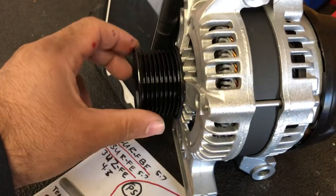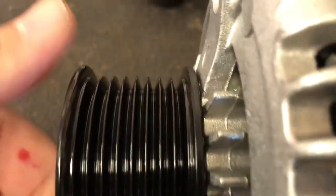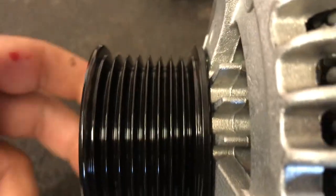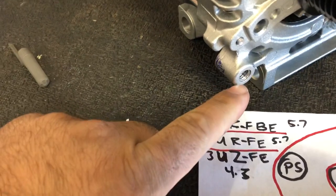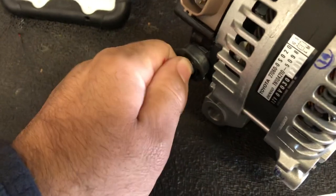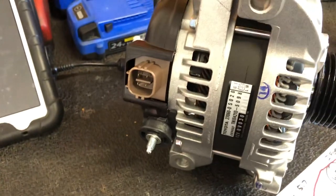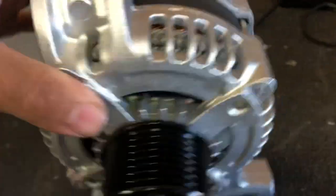Here's what the alternator looks like new. Clean up the mounting surfaces, make sure the pulley looks good — spin it, make sure it's not wobbling, because just because it's new doesn't mean it's good. Make sure it doesn't make noise before you try to install it. This is where the bracket attaches to bring your wiring around. That bracket screw is 9.8 Newton meters or 87 inch-pounds, for those who like to torque everything to spec.